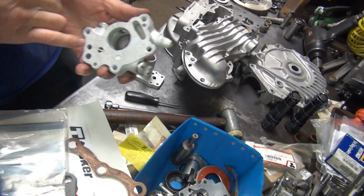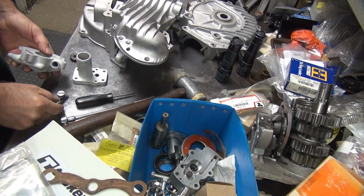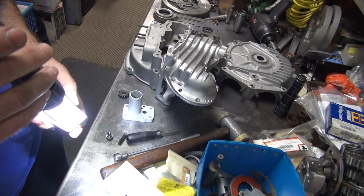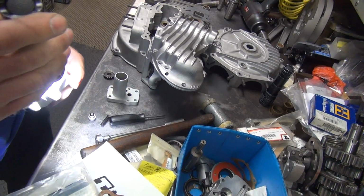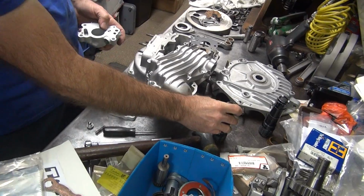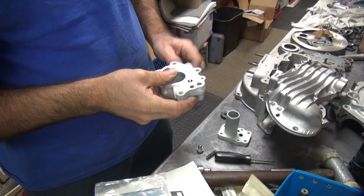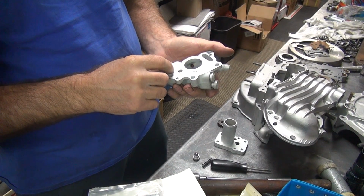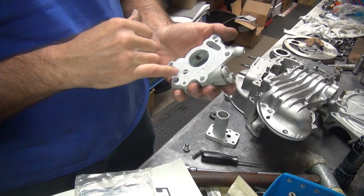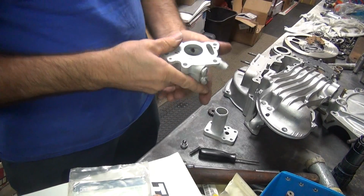My guess is it keeps it from wet sumping. Is this what this ball does? If I had to guess. See, 45s do things different than everybody else. See, it only goes to that bowl. We already know this is where the pressure builds up at. I think it's going to let it wet sump, because this is bypassing these bowls. This bowl's here for a reason. They're eliminating that bowl by having that gallery cut through there. So I think that's going to let oil leak through.